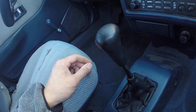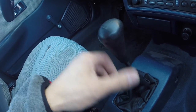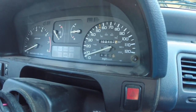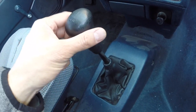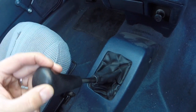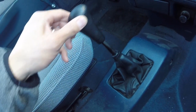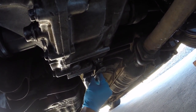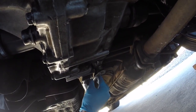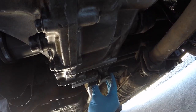If you put it into gear, I have this much of free play. My wagon has about 369,000 miles on it, so the bushing's a little bit worn out, but every single gear there's got to be at least a good two inches of play. Under here is my shift linkage — you can see all the play in that. There's like a plastic bushing in there that has just deteriorated over time.